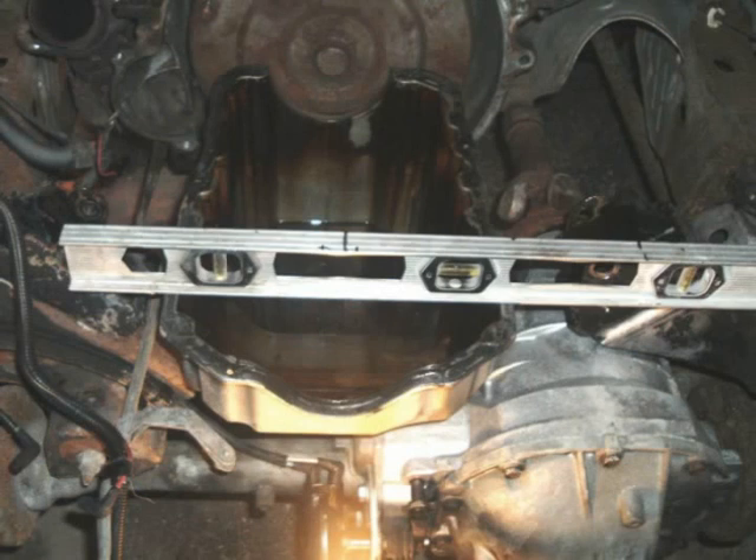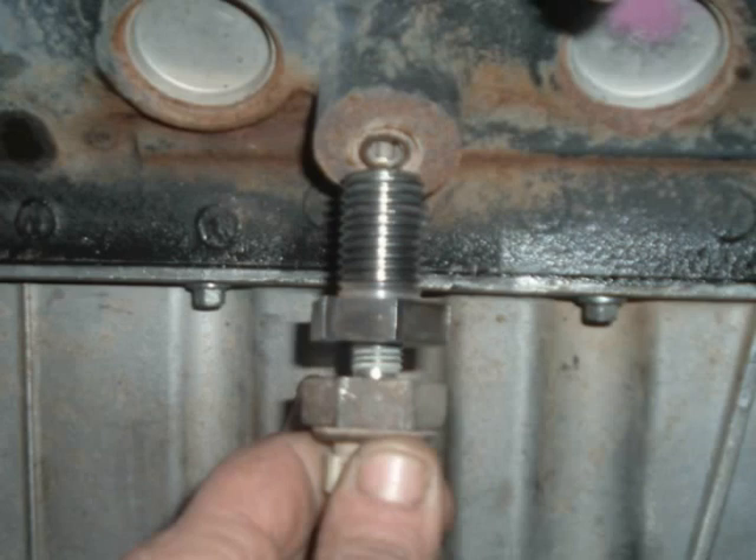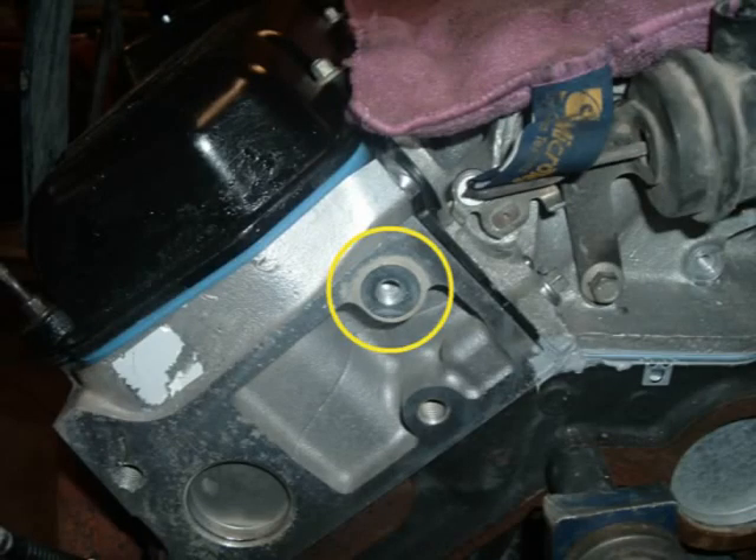Finally, I can install the accessories to the engine. But wait — we have another problem! The 1997's knock sensor is piggybacked to the coolant drain plug on the right side of the block, and neither will fit the 2005's engine. After some more research, I learned the knock sensor was changed and relocated to the back of the left cylinder head in 1999.